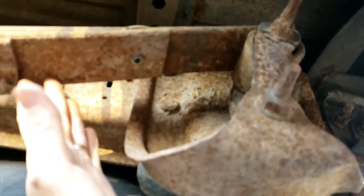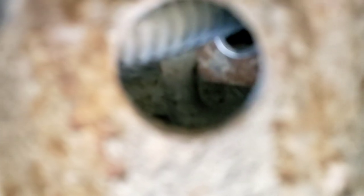There were two bolts at the rear. They're right here. If you remove your spare, you can see them and get to them. There's one here and it is straight up in there - you see it right there? There's another one right here. Where that is - on the spare front of this arm right here where your leaf shackle is. These two you loosen enough so you can tilt it back. You don't really take them all the way off.